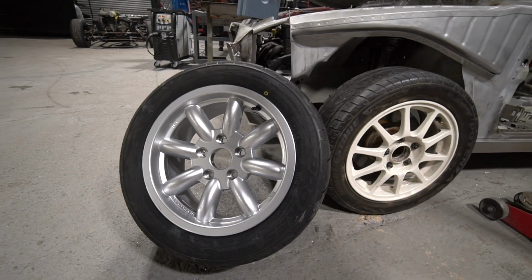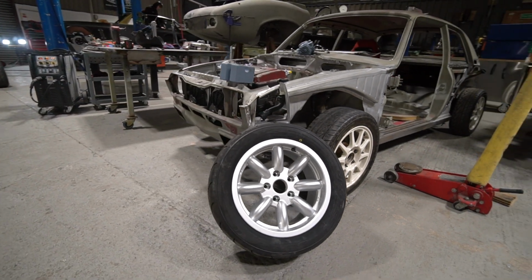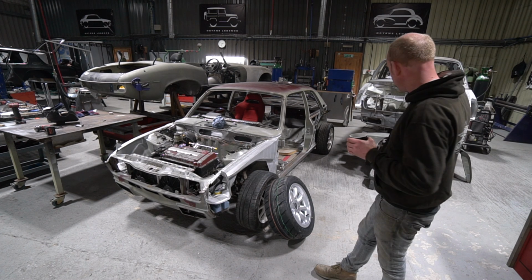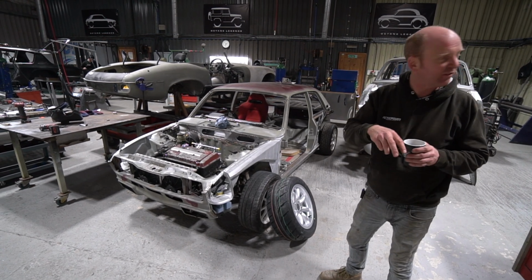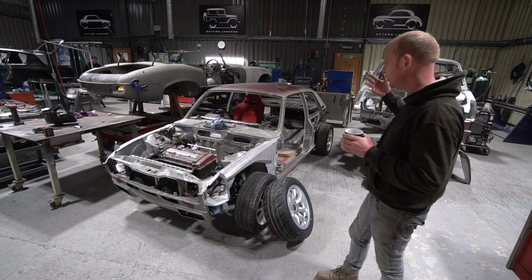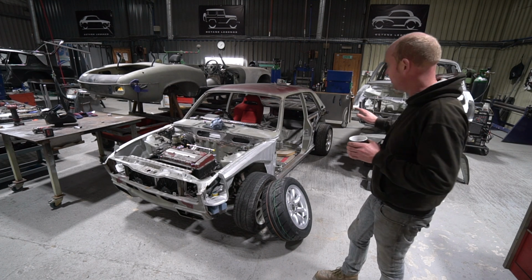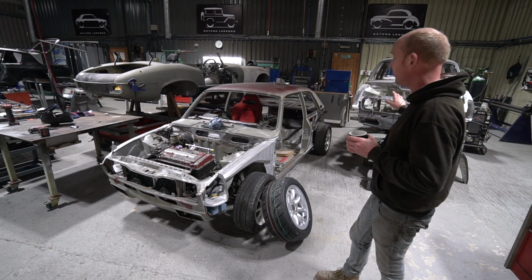There's quite a lot of grotty metal work underneath on that from where the floor pan modifications were made. Obviously underneath nothing's been dressed because it's on the jig, it's not accessible. The welds were done from the top, so the central chassis rails where they were modified, they've been welded from the inside of the car, but they need to be finished on the underside of the car, and that can't be done yet. Once that's off onto the rotisserie, we can do all that underside finishing, so that'll all be nice to get buttoned up, and that body shell will then be pretty much as complete as it can be until we get the carbon panels.